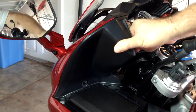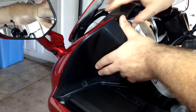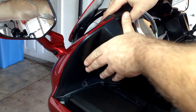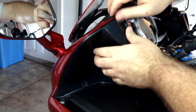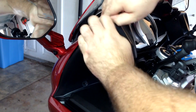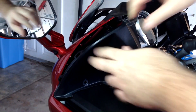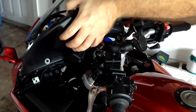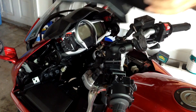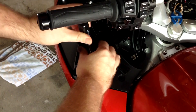Here's where I criticize Yamaha for making changing headlight bulbs this incredibly difficult. What we have to do is pry this big black part down from the panel at the top center — you just push it in forward a little bit and then pry down. First thing to do is turn the key on and pop the glove box. There's one Phillips screw right down here that's holding the two parts of this panel together; then we'll be able to take off the inner one.